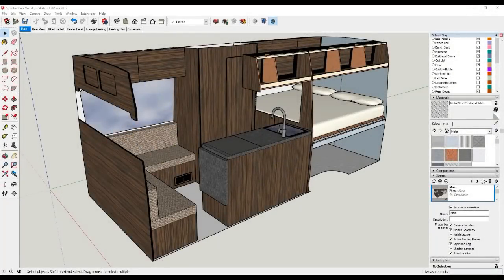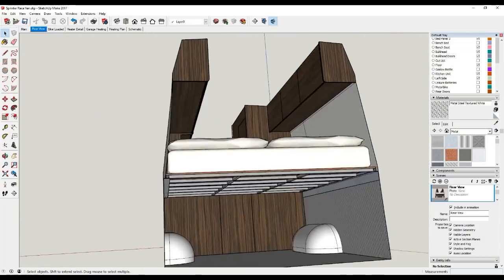This is the latest internal design for my Sprinter. Let's have a closer look at the bed section. What we've got is two folded angles down the side of the van. These are going to be securely fixed to the main structural member with some rivnuts, and then the bed is made of an aluminium box section framework made in three sections. It's bolted to the angles on the side of the van, and all we have to do is unbolt those and we can lift each panel out one by one, lay them down the side of the van, and that will give us full height access for when we're loading a bike.